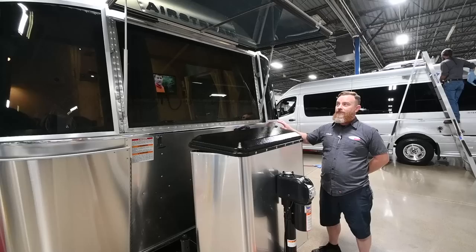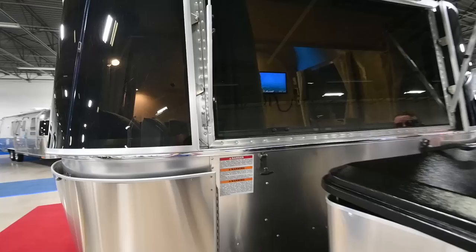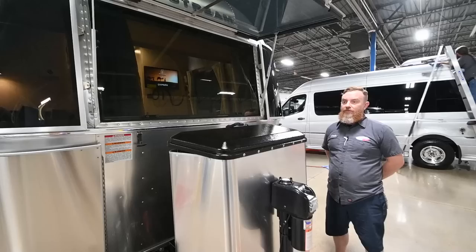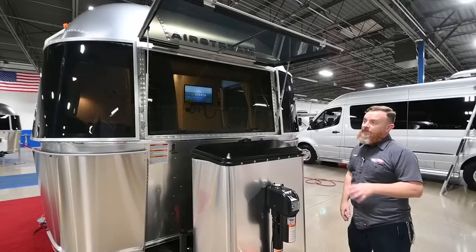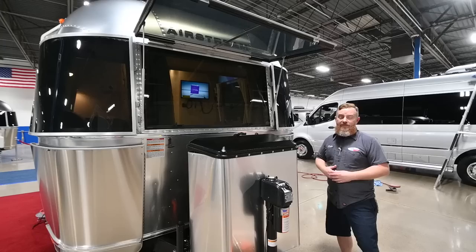When you open the center solar guard, you'll also be allowed to open the side solar guards. There are rubber gaskets around the edges, but over time dirt and leaves will get past those and the windows behind them will get dirty. The only good reason to open the side solar guards is to clean the window. The screws have a T-shape — give them a quarter turn and they'll come out of the channel, hinging away from the trailer. Make sure you have a hold of the solar guard itself; if it's windy and the wind flings it open, there's no stop and it will put a crease on the side of your trailer.